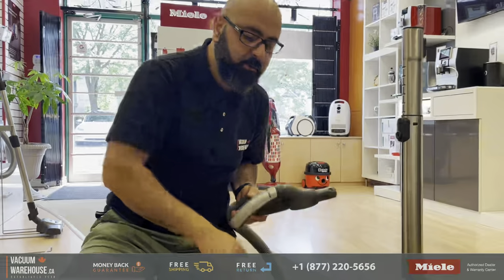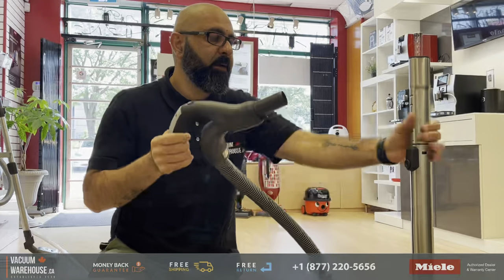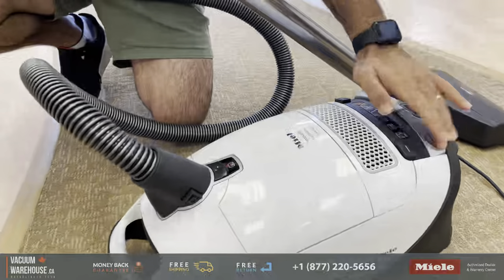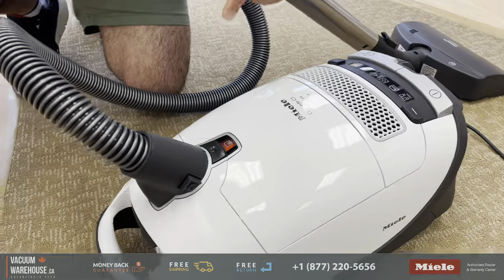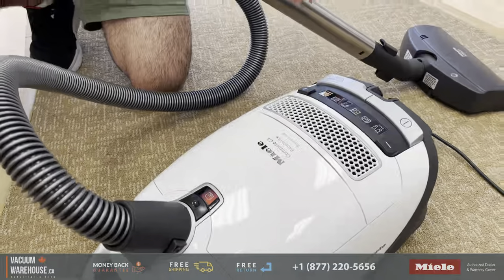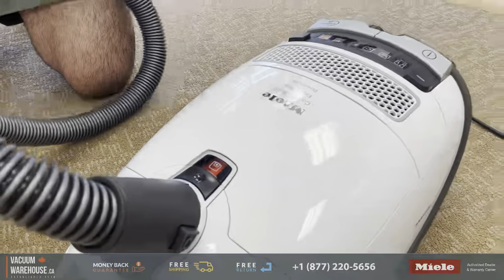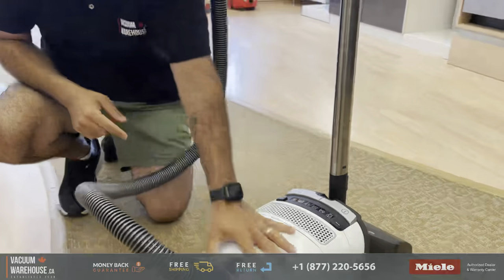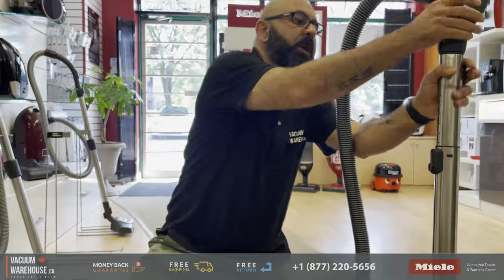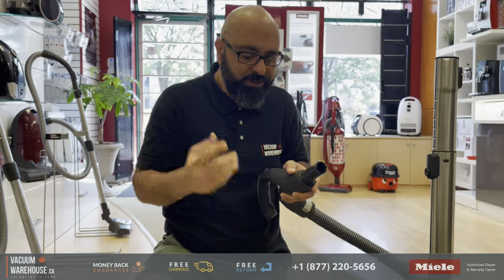Is that the most accurate thing ever? No, it's actually not. Why? Because empty bag, high suction — I'm just going to put the floor head on the ground. Watch what happens: it's going all the way three-quarters full, and all we're doing is putting this on the floor. We are obstructing the airflow. If I remove it, it's drawn back again. The true reading happens when the vacuum has a new bag, high suction, and we're not restricting the airflow in any way. The hose does restrict airflow a little bit, but not enough to make a huge dent.